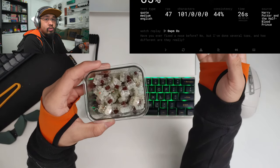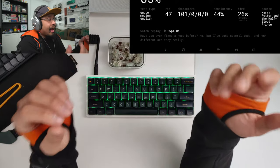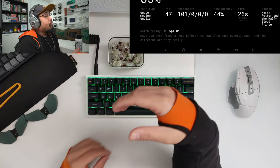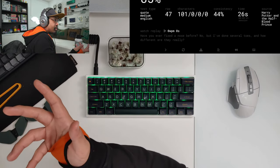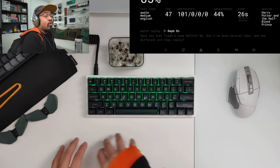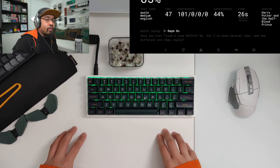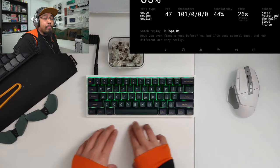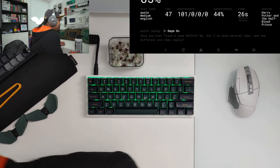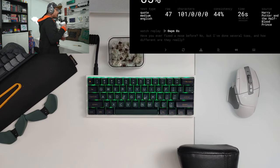And if you're able to, before you tape mod it, remove the switches out of the gaming keyboard, lube them, put them back in, and then tape mod them. Obviously, now you'll get a much better experience. If you're able to put some stuff like polyfill or a foam insert in the bottom, hopefully a high porosity foam insert, you've got it. It's great. Let me get my clicky switches.